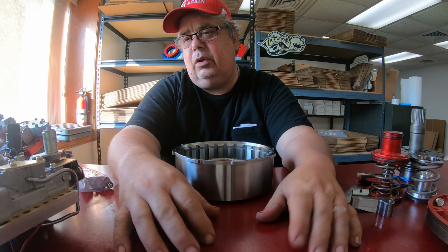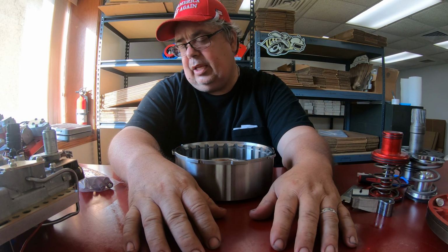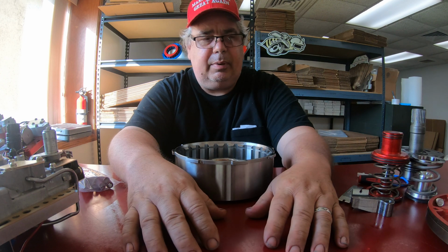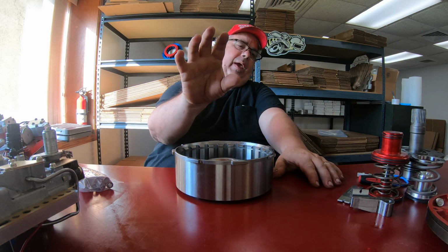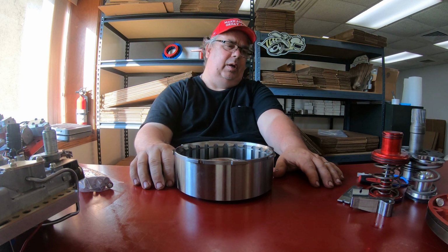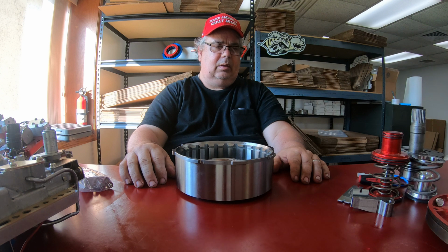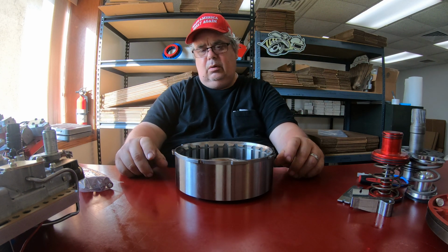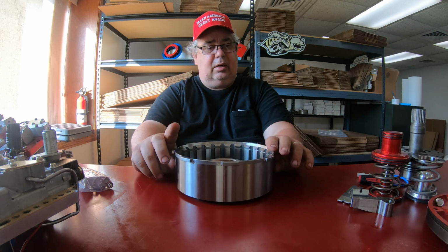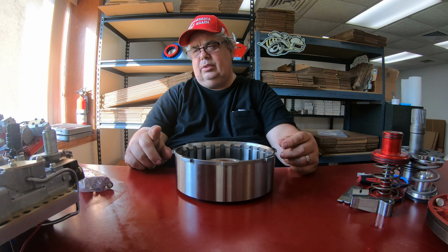Anytime they get any looser with high pressure valve bodies, unless you're using a billet Belleville spring, that front piston has a tendency to push past the Belleville spring. Then the lip seals pop out, and when they go back in, they rip. You have no forward motion. So we do sell a piston that comes in different thicknesses to take up that clearance, so you can do that.